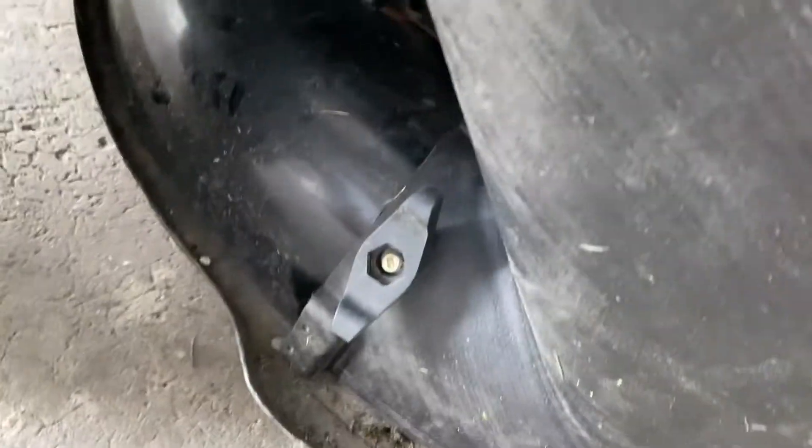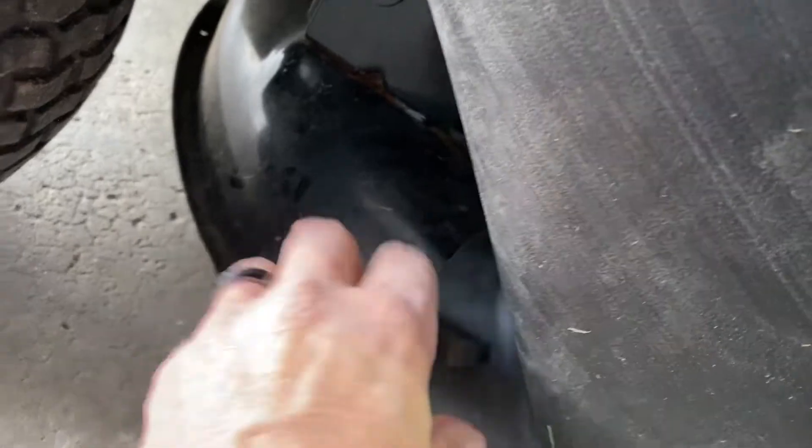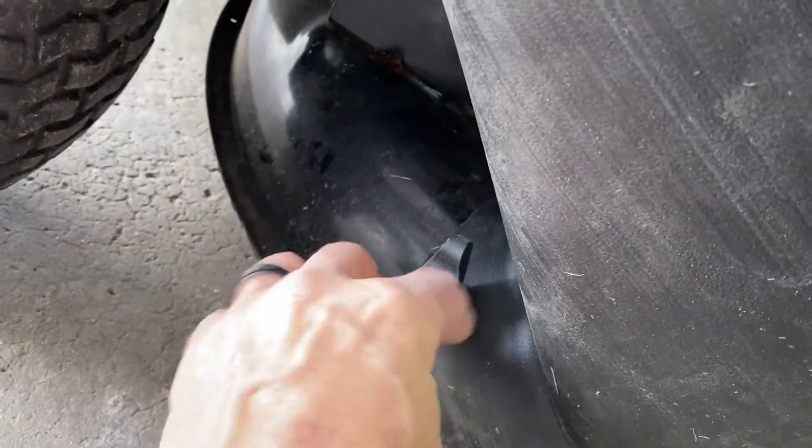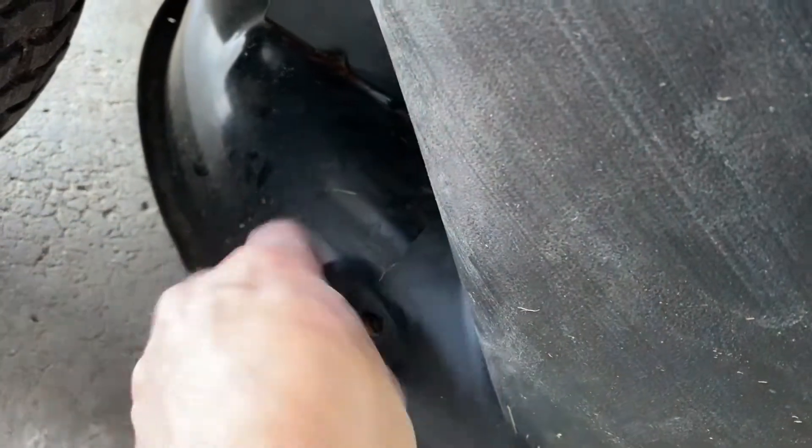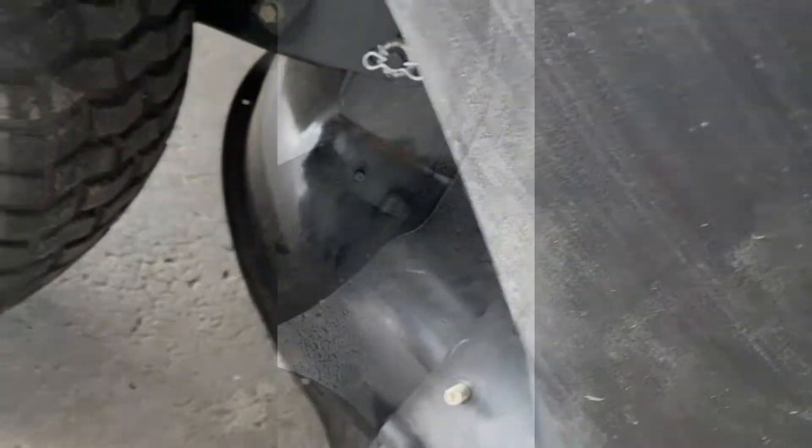You want to remove the chute — should be just two big wing nuts — that'll gain access to the right side where your air filter, oil filter, and fuel filter are conveniently located. A little persuasion on the front will pop this chute right off. Set that over to the side.